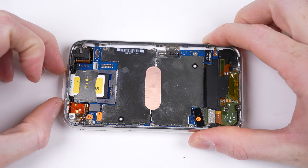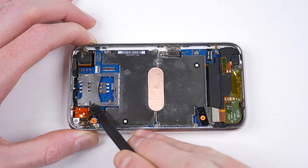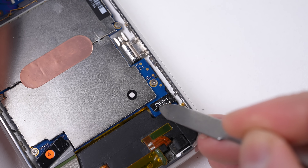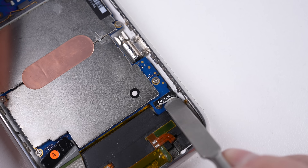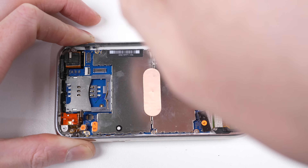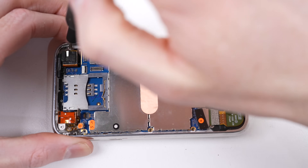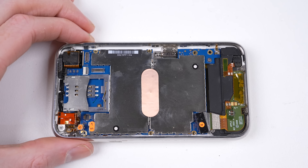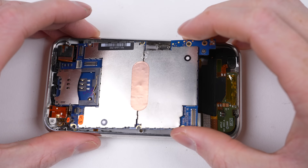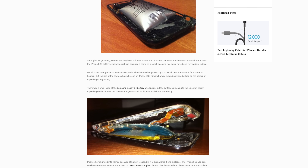You may have noticed that inside we can't see a battery. That's because it's hidden under the logic board — one of this phone's only pitfalls. You do have to remove the logic board to access it, but with only 8 Phillips screws it can be accessed in a very short time. That being said, they did also put a 'do not remove' sticker over one of the screws, hiding it, which is not ideal. The bigger issue is expanding batteries. While this particular one hasn't expanded, it's not unheard of, and because of its location in the phone, if it were to expand it would crack the back housing, push up on the logic board and the display, causing permanent damage to the phone in some extreme cases.